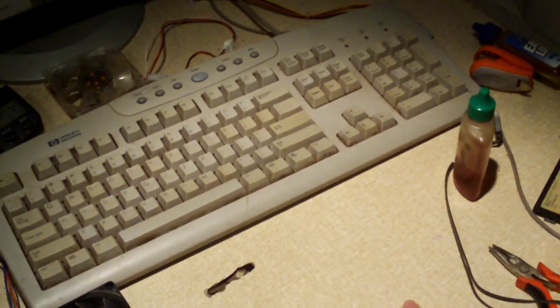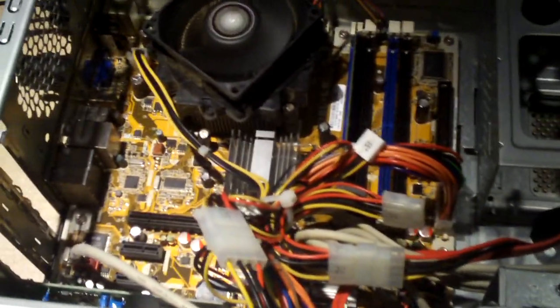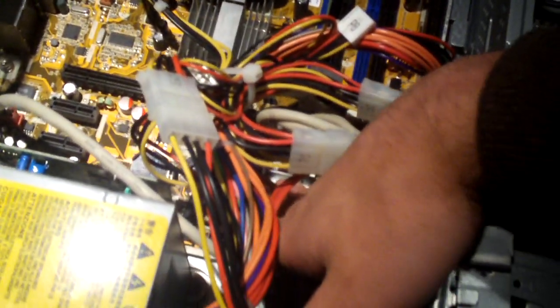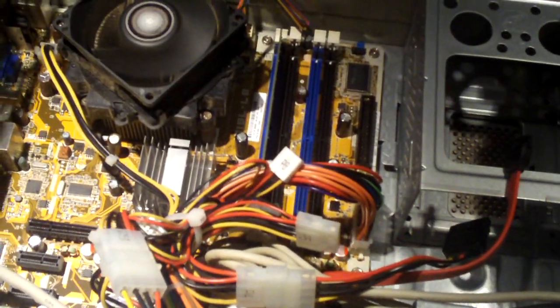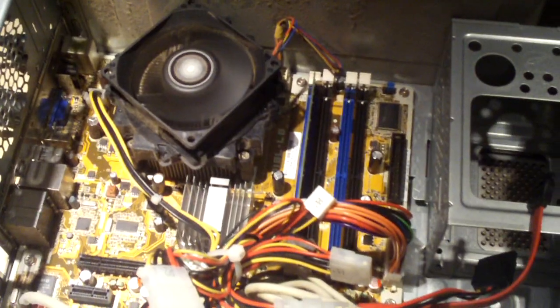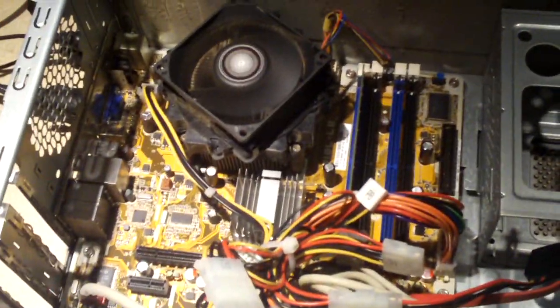What I did was hit scroll lock and up to test my KVM switch, to make sure it wasn't that. And it's not. North bridge heatsink is very slightly warm. South bridge heatsink is fairly hot. I'm supposing this board may have been hit by a power surge. In the previous system, the Acer, I believe what happened to it was the chipset overheated from improper cooling. But anyways, it seems that in this system the motherboard is also dead.